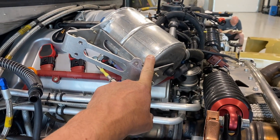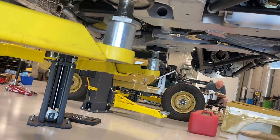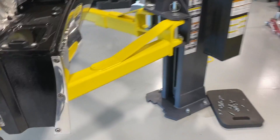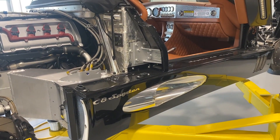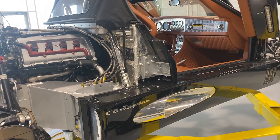Walking around, we'll see this is the tank for the dry sump oil system. It's a dry sump engine, which means the engine sits fairly low down in the chassis and you don't see a deep oil pan. For the fuel system, we have two tanks which are outboard in the sills. That's a fuel accumulator, and these braided lines are all the fuel hoses. There's one tank in there and it slides in most of the way of the side sill — putting the weight as low down and as central as possible, which is the objective of a mid-engine car for a low center of gravity and low polar moment of inertia.